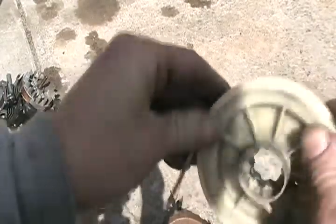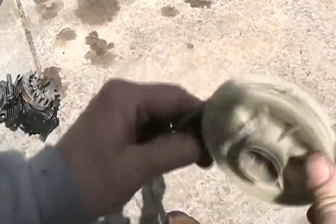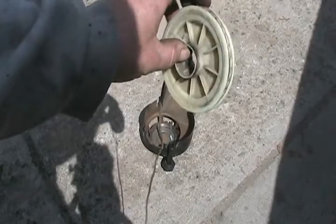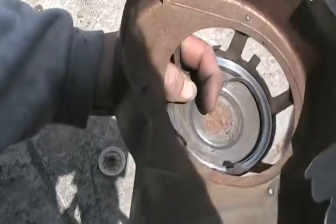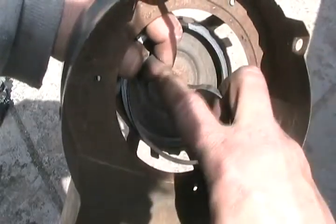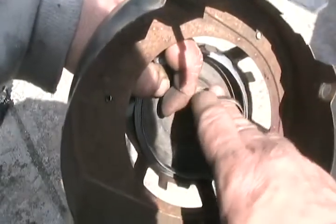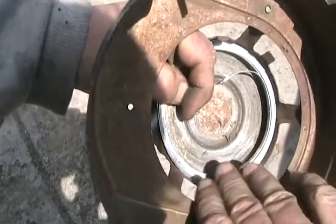There's the part where the spring is going to hook on afterwards. Wind it all the way up until the string comes to the top edge of the surface. Now the trickiest part: getting that little spring tab in the middle of that circle into the little hole in the bottom without the spring popping out. You have to get a finger or two in there to hold the spring down against the body. Get it slipped onto that wheel, tip the wheel horizontal so it locks itself, then before you let go, twist the wheel backwards. That tightens the spring to make it smaller, then start dropping the plastic wheel down into the pocket while slipping your fingers out.